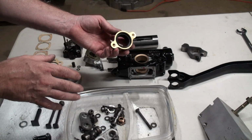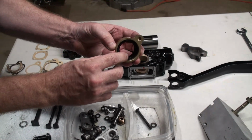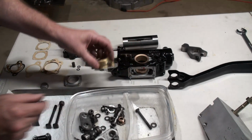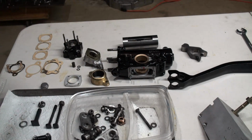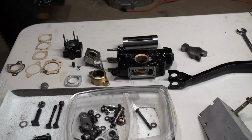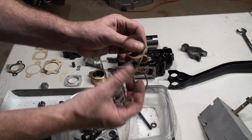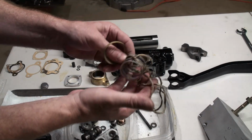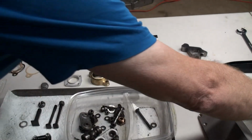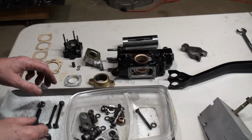With the arm, you have to have this piece here, and inside this piece are the seals. Now I bored out this housing and then insert modern oil seals. Originally it would have been this arrangement. You would have had tallow string like this, and then you would have had a bronze piece that compressed it, and a spring that held against the bronze piece. And this was a very effective seal. But going to the more modern oil lip seal is usually a better choice.